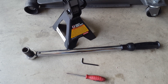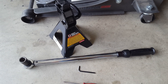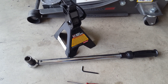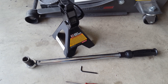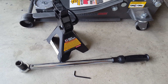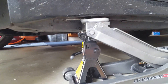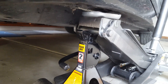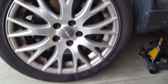We're going to jack the car up properly and put the jack stand under it, then loosen the wheel and take it off. Before all that, I'm keeping the emergency brake on — make sure you have something under the wheels as double insurance so the car doesn't roll away. As you can see, I've jacked the car up, placed the jack stand for extra insurance to make sure the car doesn't come down.